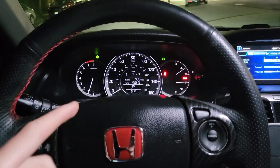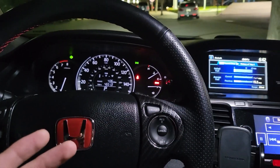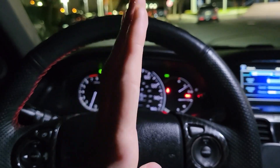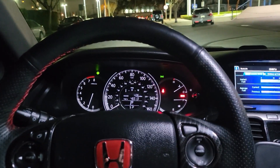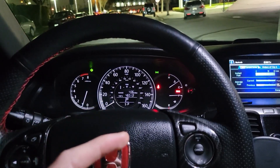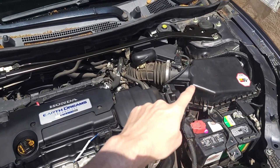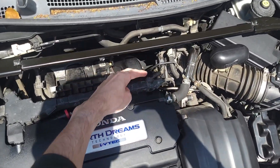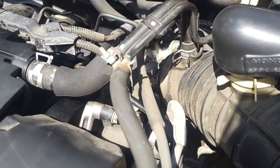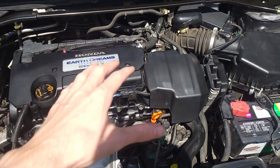So that's how you clear the code with this OBD scan tool — it's a temporary fix, and the car could do that again at any point. But at least the car is starting, so we know it's probably not a starter issue or a battery issue. It's probably just the throttle body that's not opening or struggling to open. For those of you getting that code or a wonky start — you heard it in the video, it kind of wants to start and then bogs and turns off. Looking under the hood with the engine off, you'll see the airbox here, follow it along, and from the top view you can see it right here. Just keep in mind this will be hot if the engine has been running.